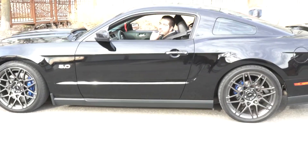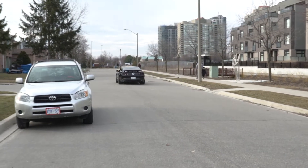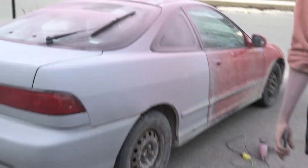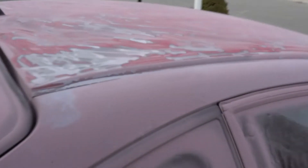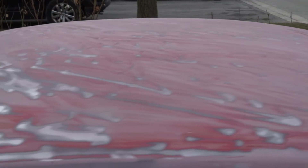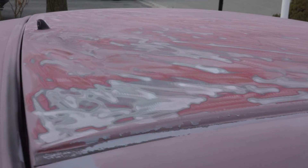I'll show you what it sounds like — this video is all over the place. You gotta make sure you drive slow if you have a car like this. My son's videotaping me. It looks a little bit dusty. I'm gonna tell you right now, you did a really bad job. I thought you were gonna go to the bare metal — it's bumpy. Anyway, take a piece of sandpaper, scuff it up really roughly, and then you can start painting this whole area. Prime it first and we'll put the bondo on top.